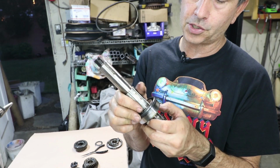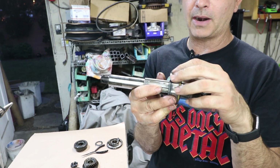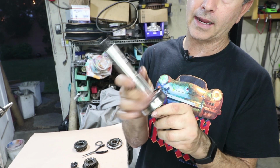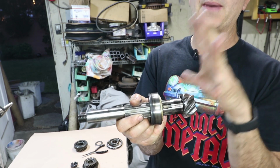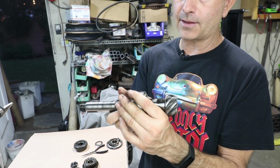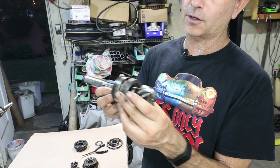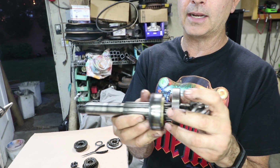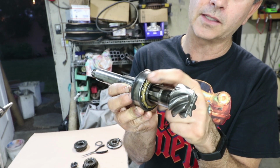Generally, you don't want to push on the rollers. So what I did is I took the old bearing race from the spare transmission and slid that over the bearing. That prevents any of the cylinders from expanding out and losing pressure, so this keeps the bearing together. Then this piece is just a nice fit that goes right over the top of the cage, and it actually does push on this side of the cylinders.